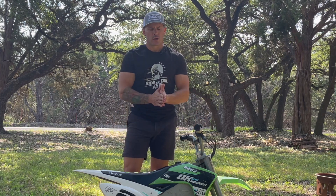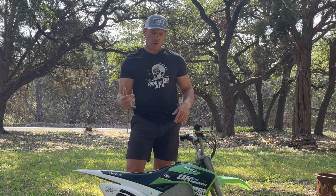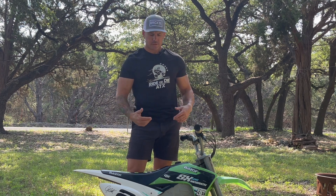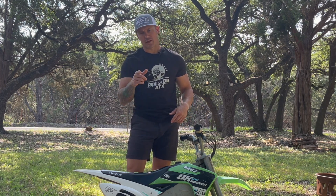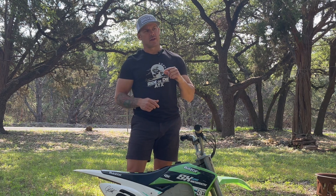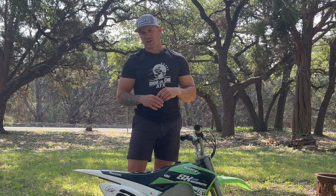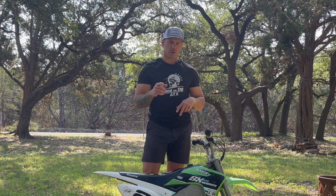You ever get your MY1020 motor installed and you're super jacked thinking this is gonna be badass, and then you go to turn it on and it goes backwards? It happened to me. I figured it out. I'm gonna put a diagram at the end for y'all to look at. Your motor turns backwards, it's got a loud sound — a couple things could be going on. Maybe you need to move your phase wires around. Check that diagram out. Here I'm gonna show you how my motor started in reverse and then I got it to go forward.